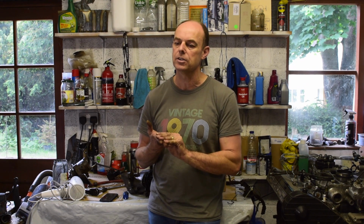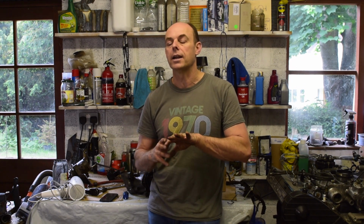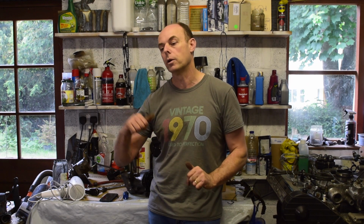I also have a concern about, now I've decided to not do the aircon at the moment. That means, and I'm going to delete the smog pump. So on the left side of the crank there are going to be no belts pulling on that side, whereas on the other side I've got the alternator and the power steering pump. So I'm worried about, and I seem to remember someone maybe 6-9 months ago mentioning it, that the crank will be pulled in one direction and that will wear the bearing unevenly or badly. So I'm wondering whether I can use the smog pump, strip it out and use that on the left hand side to equal up the pull. Equal the load. So I'm going to be looking at that as well.